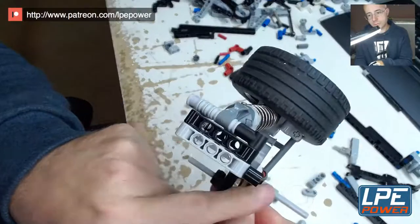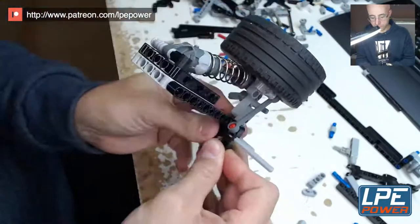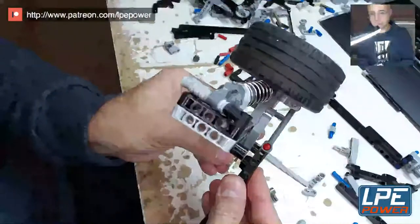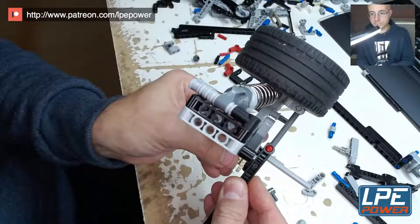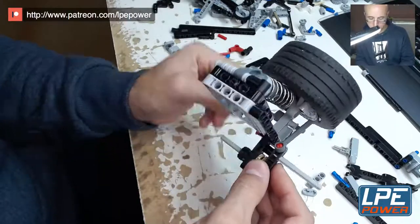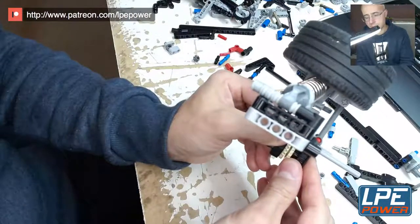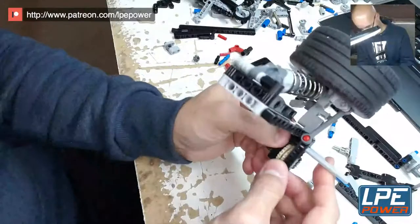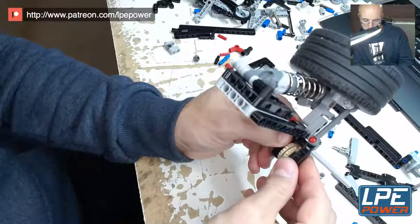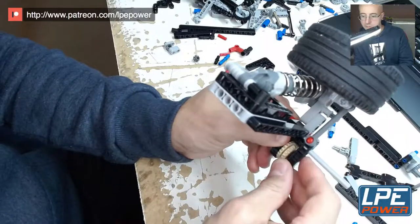We do have, of course, a problem because it's a slight toe in, but that's not really a problem because we can just basically move the entire steering axis a little bit out so that it's perfectly parallel. See? And then the toe in that we have now, when we move the steering axis out, is gonna disappear. Okay,